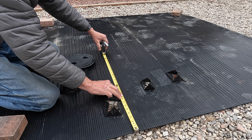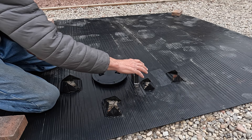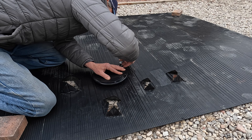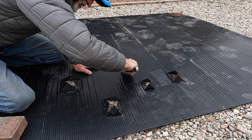As we were replacing the corrugated poly underbelly panel beneath our RV that was damaged in the water tank mishap last week, that gave us the perfect opportunity to place the cutout for this six-inch marine inspection hatch right in the underbelly before we put it up under the trailer. If your underbelly panel is not damaged, you can simply trace out the hole for the inspection hatch right in the underbelly panel as it's sitting beneath your trailer, being careful not to damage your water tank in the process. The poly underbelly material is soft and easily cut with a utility knife.